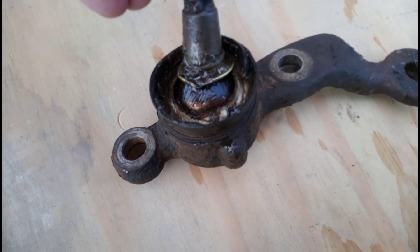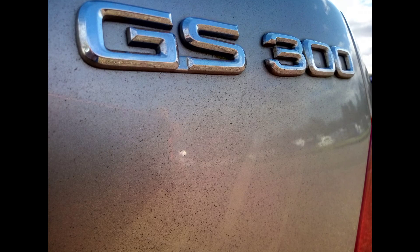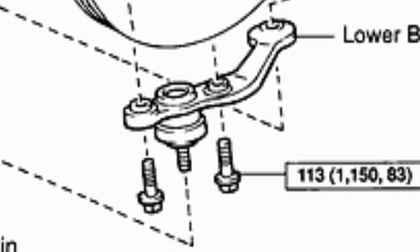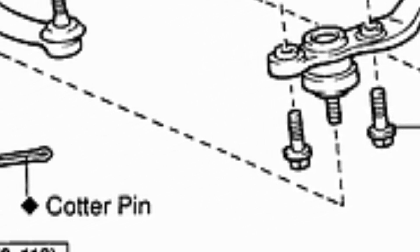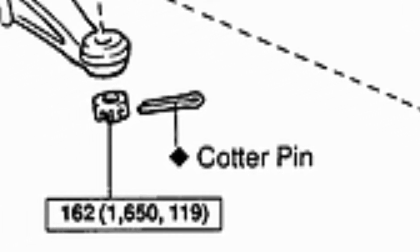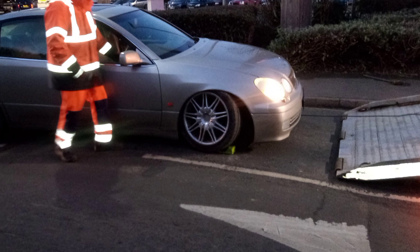Effectively the ball socket needs to be greased and watertight at all times. With the Lexus GS300 Mark II, the ball joint should be torqued to 162 newton meters, which is the equivalent of 119 foot-pounds of torque. This is pretty tight, and it has to be because it is of such importance to the structural integrity of the car's steering.